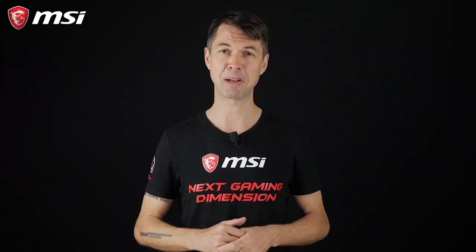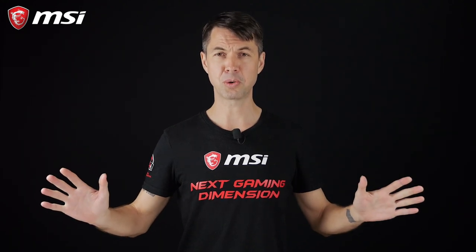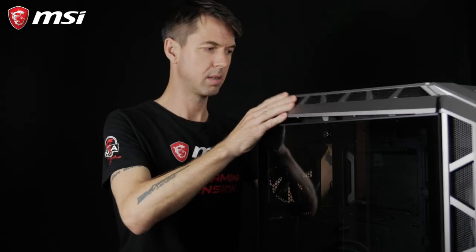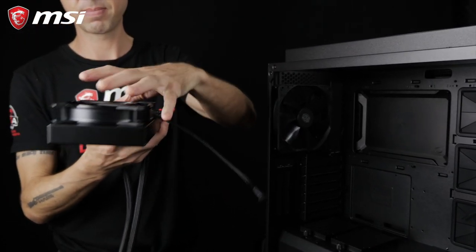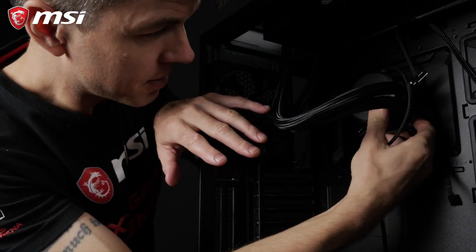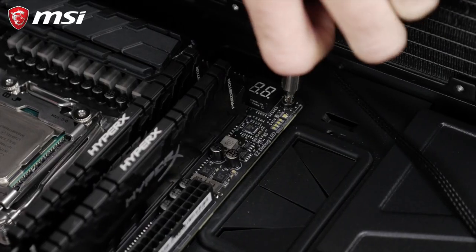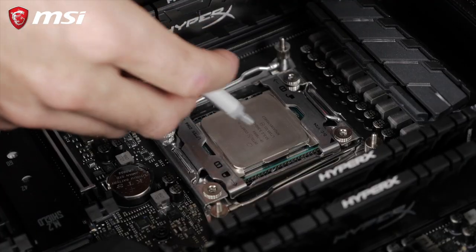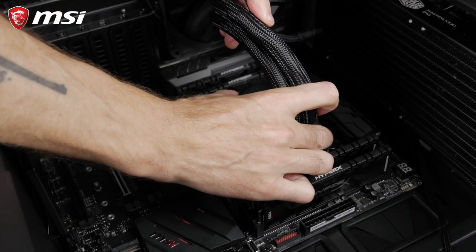Your video editing PC is not the kind of system that will be idling most of the time. Rather, its CPU, storage, RAM, and GPU will be tasked with intensive workloads, so you must make sure all the parts stay cool even when running at 100%. Cooler Master is providing us with the MasterLiquid 240 all-in-one cooler. With X299 and AIOs, there are three main steps to consider. First, mount the AIO radiator to the top of the case, positioned comfortably without hitting other components. Then lower the prepped motherboard into the chassis and secure it with the supplied screws — be sure to place the I/O shield at the back before mounting. Finally, mount the pump and water block onto the processor. No back plate needed — just take the right screws and directly mount the cooler onto the CPU. Easy.